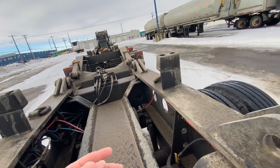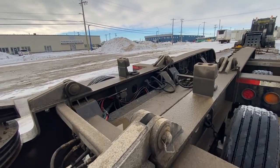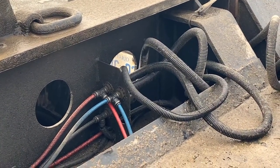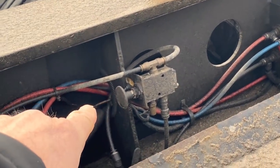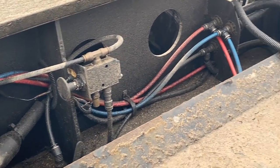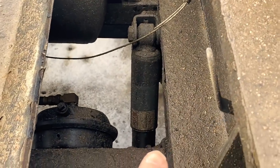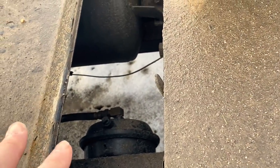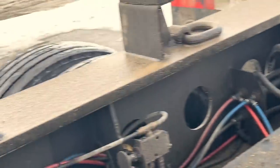The problem is it has a different design — there's too much different plumbing. On that axle there's nothing on this side, no taps, just hook up everything over there, and that's your drain valve. You can close all these taps on the airbags, but the major one is this one — that's your override. If I put it down I can inflate it as much as I want, which is sometimes helpful.